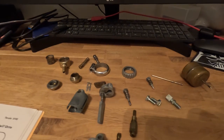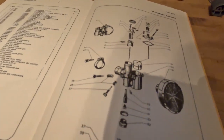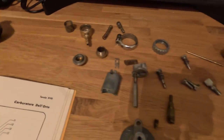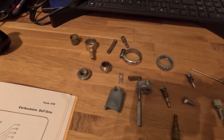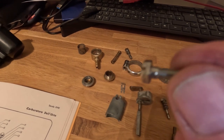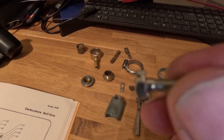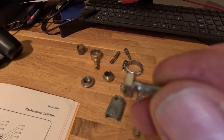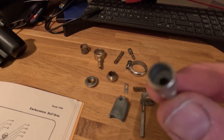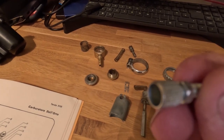Here are all the bits for the LC. You can see the breakdown in the original parts manual showing how it all fits together — fairly simple and pretty common to most carburettors. I had a number of things replated: the screws that hold the float chamber cap on are actually quite special little screws with a shoulder on them to ensure proper location. Rather than replace them with new stainless steel ones, I had these re-zinc plated so they're nice and shiny. Same with the cable adjuster — those look nice and new.